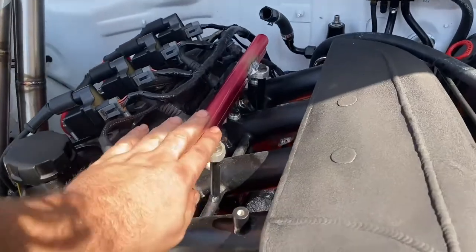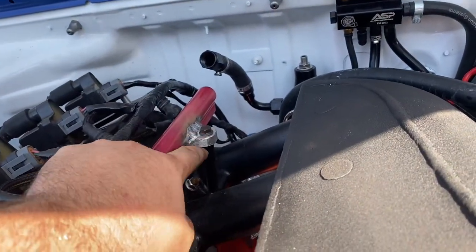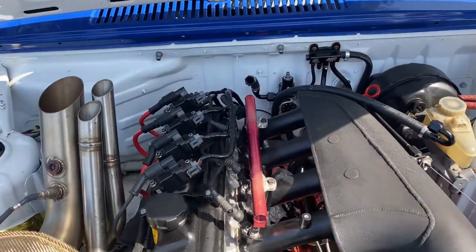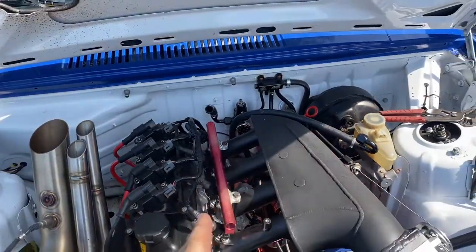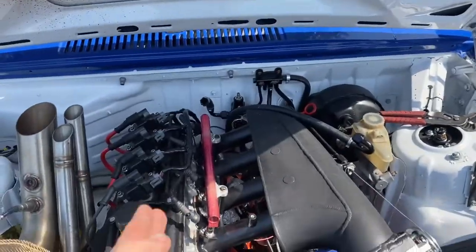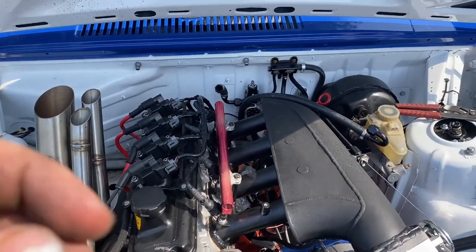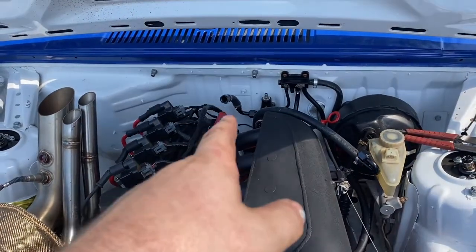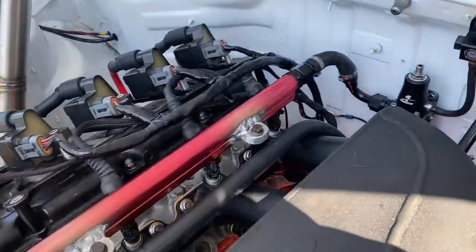Here's the new rail setup. It's got quarter-inch thick brackets welded on the underside and top side. My welds are trash, I know, but I get things done. This thing is insanely strong now — no chance of it swinging upwards like it was with the cheese ball brackets letting the injectors blow out. I gotta take it back off, clean it out, seal everything up, and then we can fuel pressure test it. Hopefully that rear injector wasn't damaged in the blowout. She's put back together.